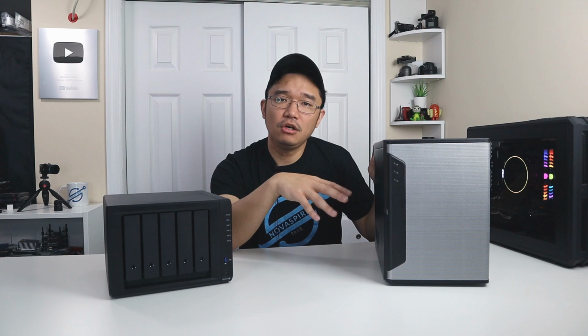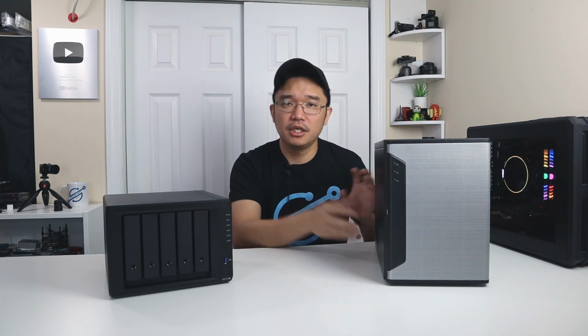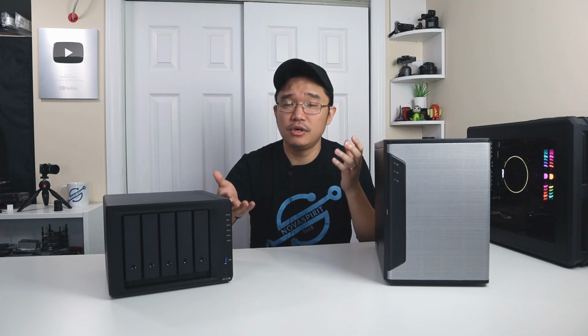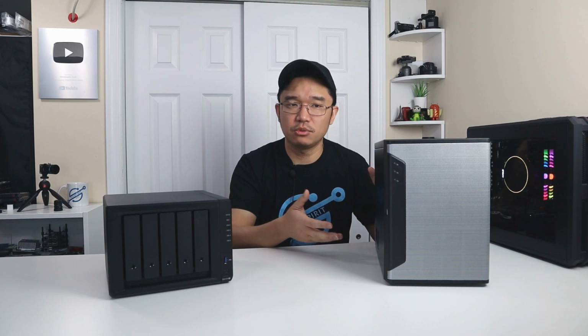So to give you guys a quick idea, transcoding a 1080 video takes 200 megs of RAM on the graphics card. And if you got 2 gigabytes, on paper, I should be able to get about 10 streams with a 2 gigabyte GPU like this. But you know, sometimes the actual video takes a little bit more than 200 megabytes, more or less right around there. So it does like 7 streams, 8 streams comfortably. And then any more than that, it kind of struggles.